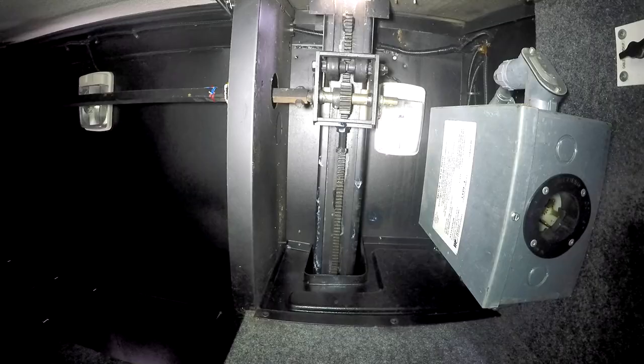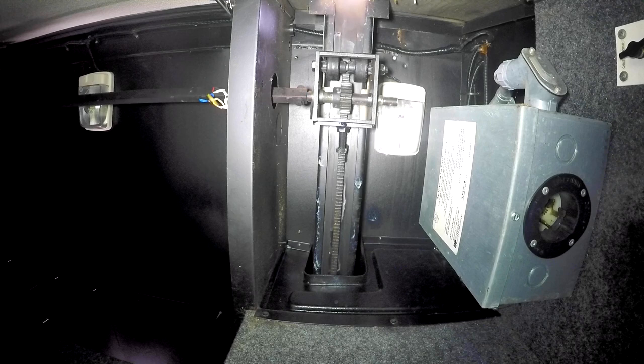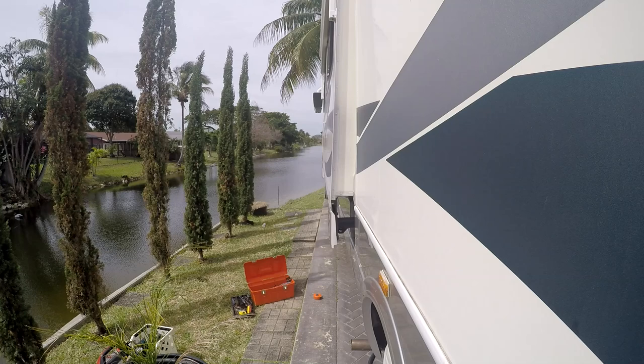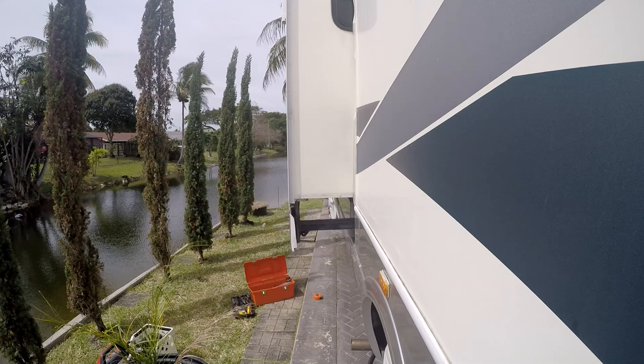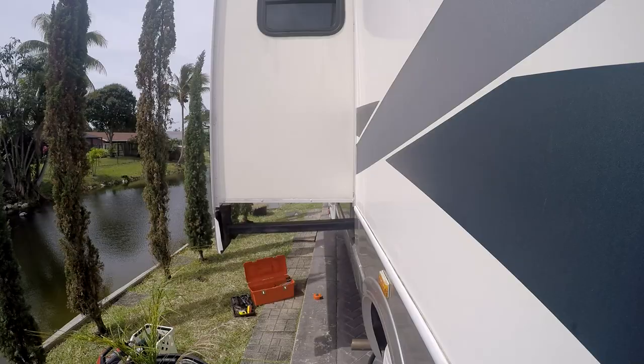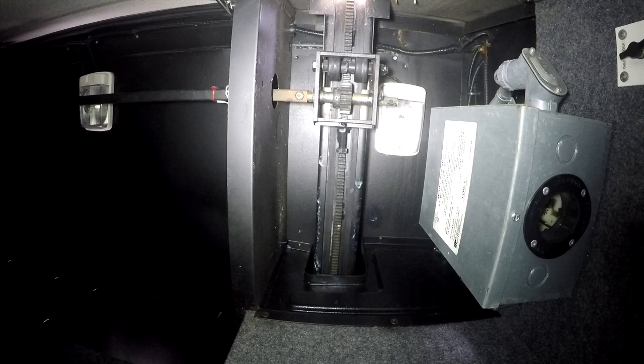Keep in mind that depending on the size of your slide, you may need help moving the room by hand. Mine was very easy to move — by sliding the slide out about a foot, it was sitting on the roller which sits on the floor of the motorhome, making it easy to move those few inches. Just to be safe, I'm extending and retracting the slide a few times to make sure it doesn't go out of alignment again.